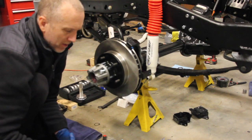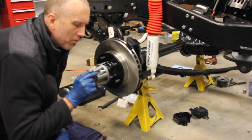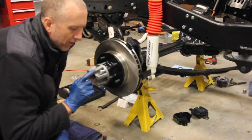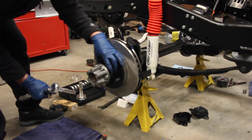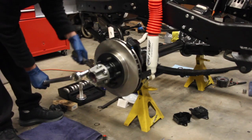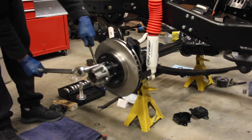Put the hub bolts on before you put the cap on, because once the cap is on it's almost impossible to get the bolt inside the cap and into the thread. These get torqued down to 30 foot-pounds. You'll probably need some kind of pry bar to give you leverage since the hub spins freely — even at only 30 foot-pounds, it's hard to hold it and torque simultaneously. Get all bolts down to 30 foot-pounds.